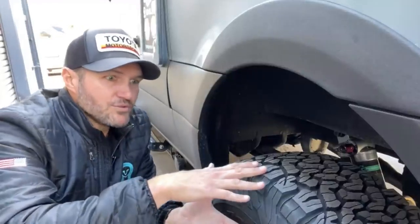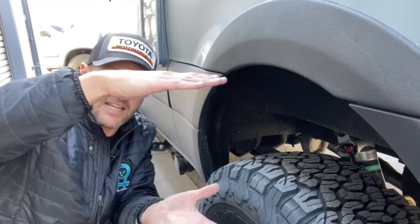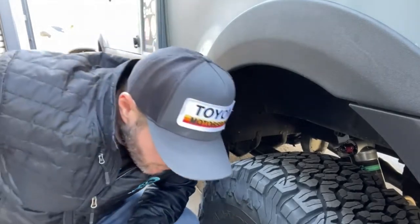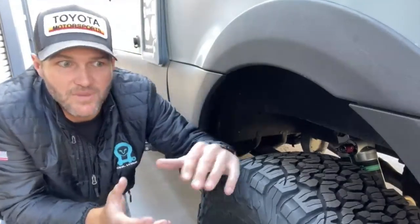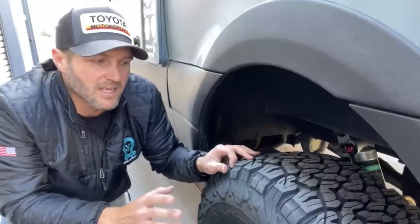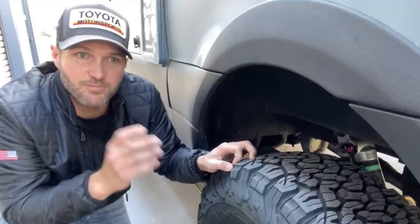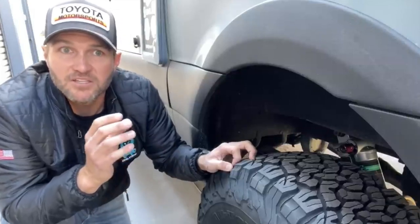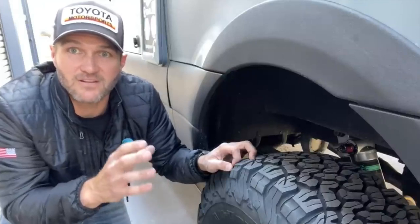Basically, when you jack a van up into the air, the tire is going to drop and the spring is going to extend slightly, and then you lower it onto the wheels and the van is going to, with its own weight, create a certain amount of compression of that spring. A stock Sprinter that you buy off of the showroom floor is empty, and Mercedes-Benz are not morons. They know what they're doing. They design the spring pack, or the rear leaf springs in a Mercedes, to be the correct spring rate for a fairly empty van.